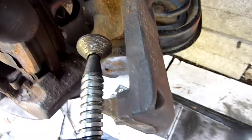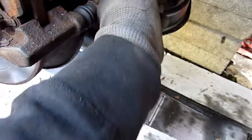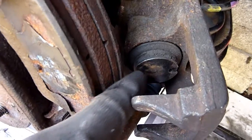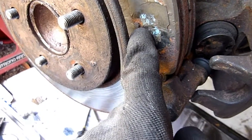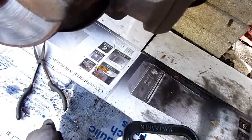Turn it very, very slowly, because there's some sort of diaphragm in there and you don't want to turn it inside out. For this type of piston, you can see the two holes there — those two holes need to match up. On your brake pad there's a little knob sticking out, so those need to align.